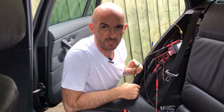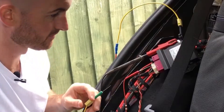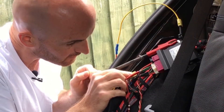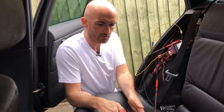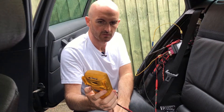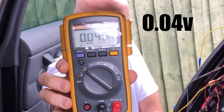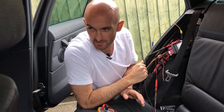Still taking a measurement on the CAN Low wire. What I'm going to do now is short the CAN High to ground. So there we've pretty much gone down to zero volts and all sorts of things have started happening because the network isn't happy with what's going on. We've killed the network.